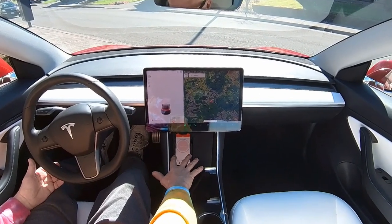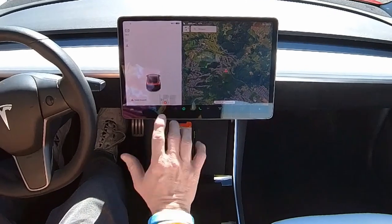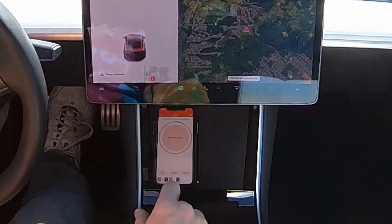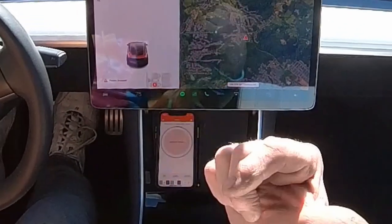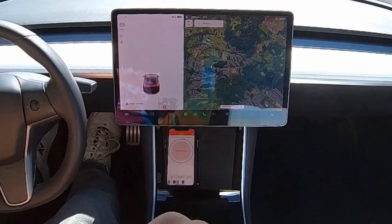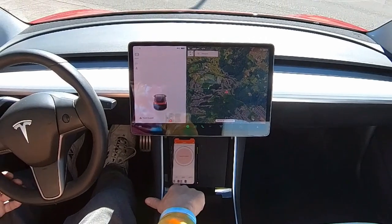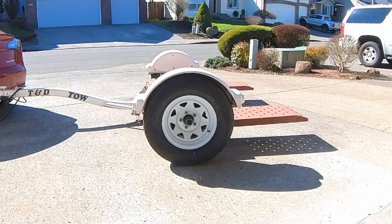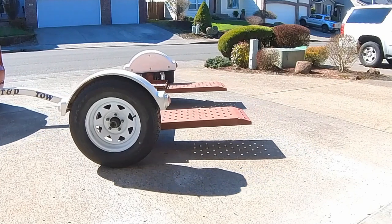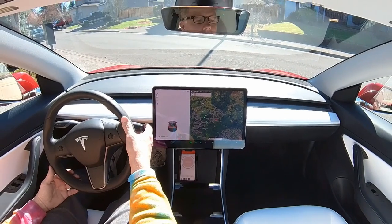We got the cell phone hooked up here. We got it set to 100% right now. I'll start rolling forward a little bit and then we'll apply the brake and see if it locks it up. It should lock the trailer wheels up because we have no load on it and 100% max output going to it. I'll just start easing forward — yep, it's just skidding. So that does work. And it rolls when it's not on.